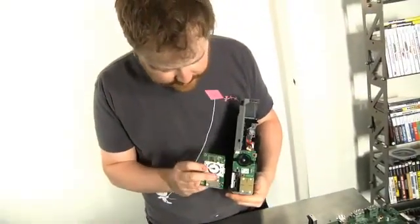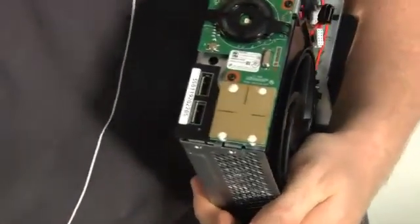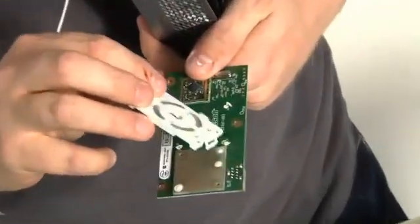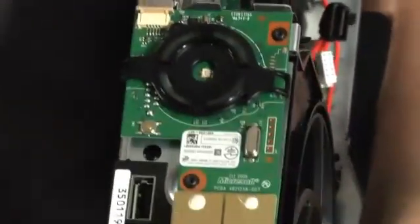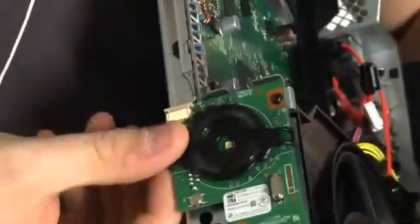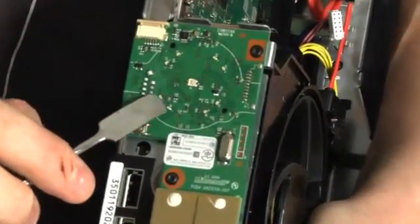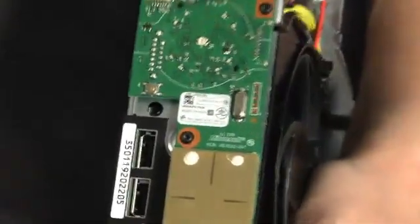You can see the difference on the front panel buttons. On the old Xbox, these lights are actually on the board and these are just diffusers that show through the bezel to show you the green or red rings. The physical button is right here on the old one. On the new design, there's no physical button — it's all just a capacitive touch sensor on the front. The lights are still around the edges, plus there's a light in the sensor, but the button is gone from the new Xbox bezel.